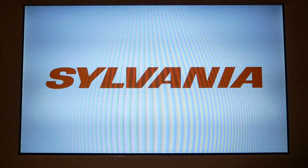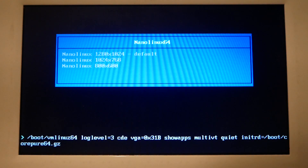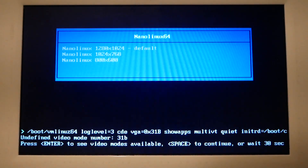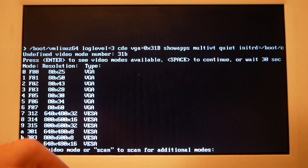The video selection menu is option 8. Option 7 or 9 was 32-bit so I chose a 16-bit mode. To select screen resolution at boot you can press Tab to edit or Enter to see more options. The smaller resolutions under option 7 are a bit too small, but something like 640x480 could work since it avoids leftover screen space you'd have to scroll through.